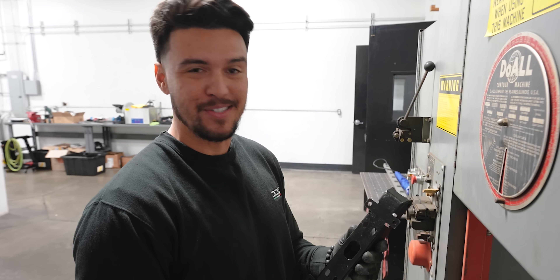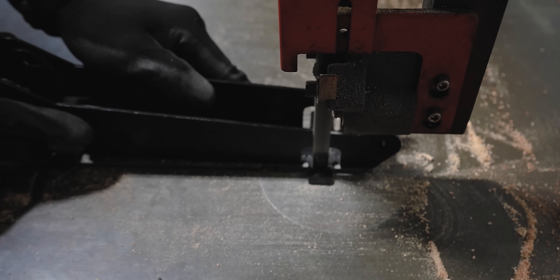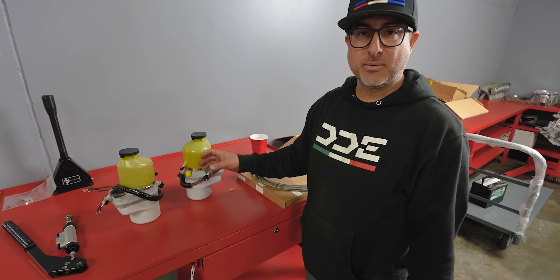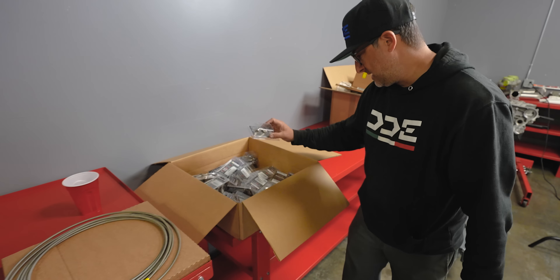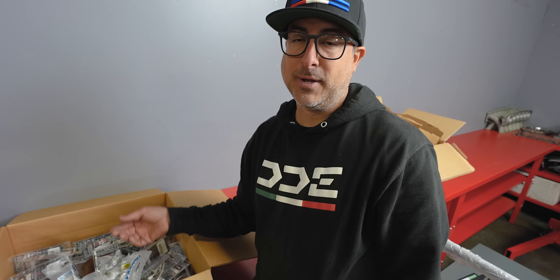I'm going to cut these tabs on the bandsaw. Also unboxing some new parts we just got: these are Porsche Motorsport power steering pumps — we now have two more. We've already got one in the F12, but these are going in the 599. The stock pumps died really fast, so we're upgrading those. We also got a bunch of steel braided dash-three line and a ton of fittings so we can adapt the e-brake into the Street Evo and both 599s. Lots of work ahead, but first let's get this Street Evo handbrake installed so we can test it out.